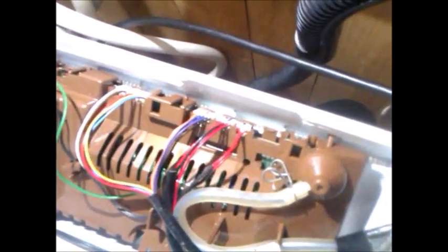On phase five, six, and seven, some of these plug sockets or wiring harnesses can become dirty and disconnect from themselves. So if you have a faulty machine, sometimes it can just be a matter of lifting the plug out and in again to give it a good contact.